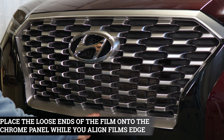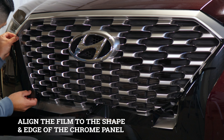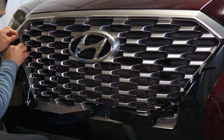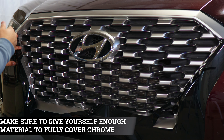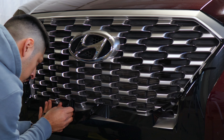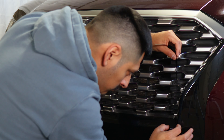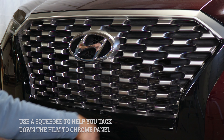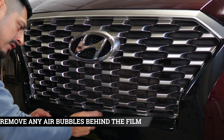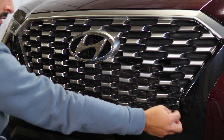Now we're moving on to the next piece that covers this section. Place the film onto the grille and start from one end, making sure you start right on the edge. Align it right on the top section — you can go a little bit higher so it matches where we left off. Follow along with the rest of the design until you reach the other end. Once you finish placing the film, grab your squeegee and start tacking down the entire panel. Make sure to take your time squeegeeing all of the air out, secure everything first, then we'll apply a little bit of heat to help it tack down around the curves and these two sections.